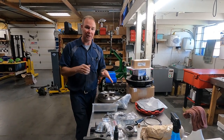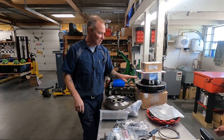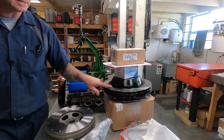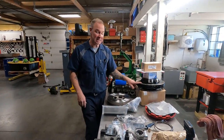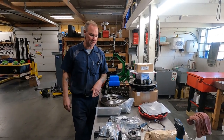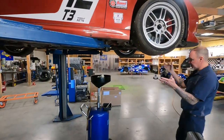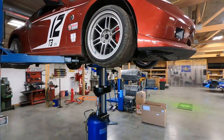In a race car I want it to hit as hard as it can, so we're going to go away from the dual mass. Also, I finally got in the two-piece rear rotors — it took almost three months to get these. Aluminum hats with the rear rotors, these are five pounds a piece lighter in the rear. The fronts were ten pounds a piece lighter. So as soon as I get these differentials under control, it is time to start tearing the transmission out of the Z car — that's next on tap.